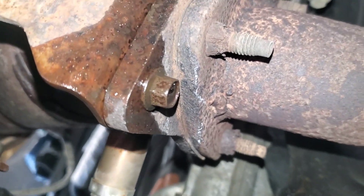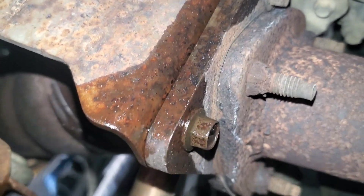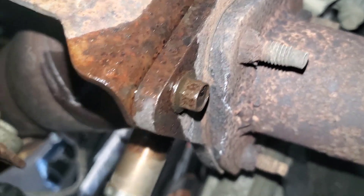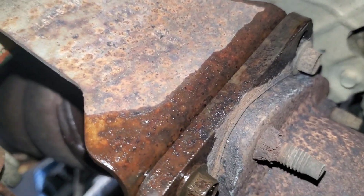It's a little tight fit. Sometimes I'll get them with a pipe wrench, but this one's not going to work with a pipe wrench and it's not going to work with the special crowfoot adapter I bought either. I lost some of the footage I filmed, but the 22 millimeter open end wrench took the oxygen sensor right out without too much trouble at all.